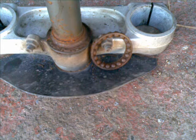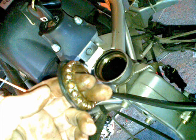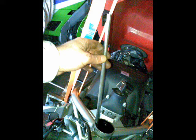It looks like the bottom yoke is out and it's kind of rusty, which is a bad sign. Here is a rusty bearing in the bottom of the frame. This is looking into the frame to see the lip of the races for the bearings, and here are the bearings which you're going to knock out with a sturdy pin.